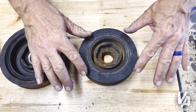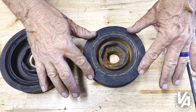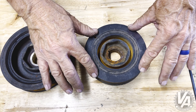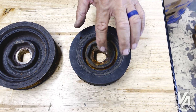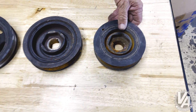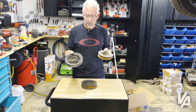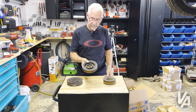This particular one is Honda's version of an underdrive pulley. If you put this on your K24 it will make more horsepower because it will spin the water pump slower, the power steering pump slower, and the alternator slower. This actually results in less parasitic drag and will increase your horsepower. So if you've got a bad motor with one of these pulleys, don't throw it away — save it. The other one you can toss in the bin.